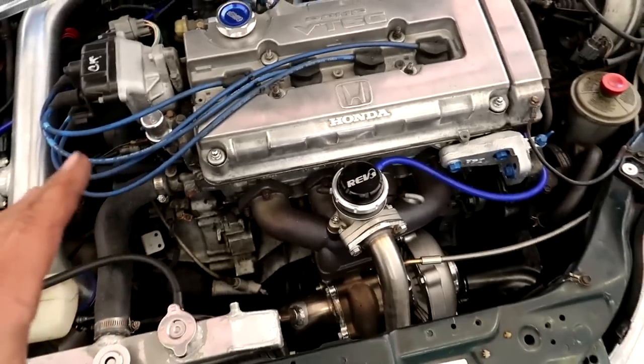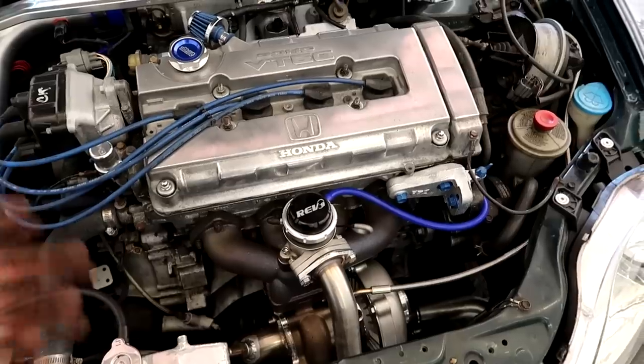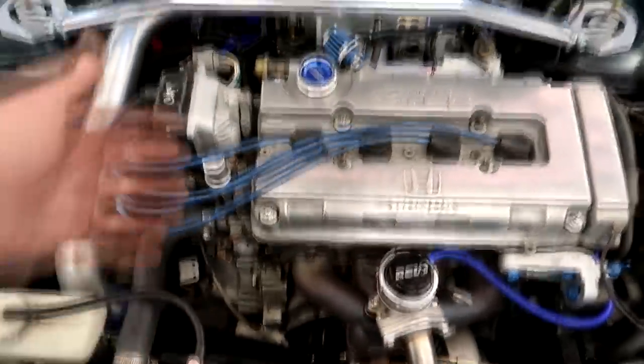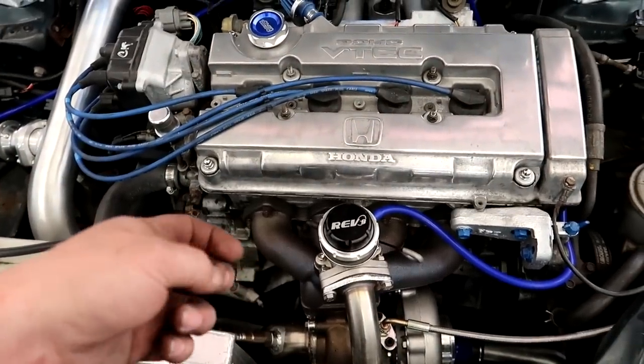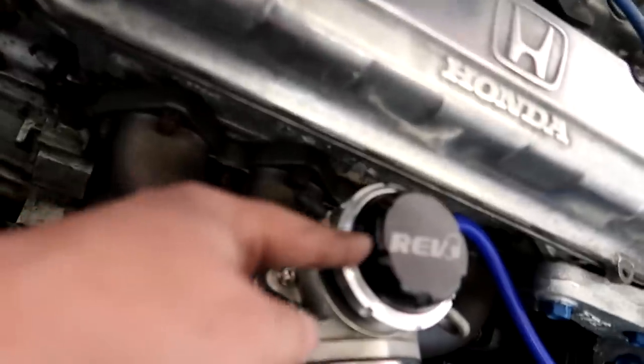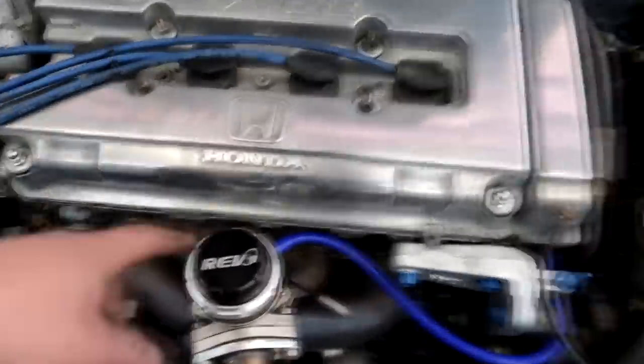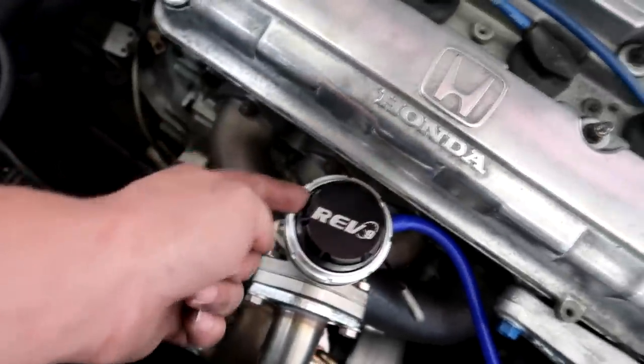This car has a 50-ish trim, basic run-of-the-mill T3 turbo, with a 5-bolt downpipe to a 2.5-inch exhaust. It's just an open downpipe right after the motor, not hooked up to the rest of the exhaust. He wants to leave it open downpipe for now and hook the exhaust up later if he gets sick of the noise. The wastegates come pre-installed with a 5-6 pound spring. I did have to remove one of the plugs on the wastegate because there was no vent on top — both ports were plugged.